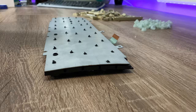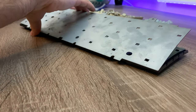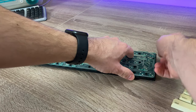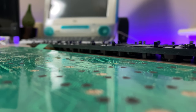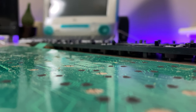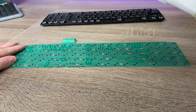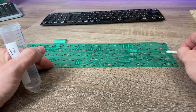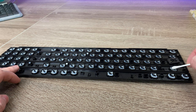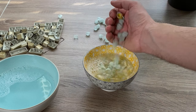Now on the back of the keyboard, there's one small screw and a ridiculous number of clips. With that off, you can see the flexible PCB. And as you can see, it's also filthy, so my first step is to clean that up in case that's causing the issue with the keys. Just being careful of the contacts here — you can see how grimy it is. I'll clean all the contacts with some IPA, then give the rest a good scrub. Time for a cleaning montage.